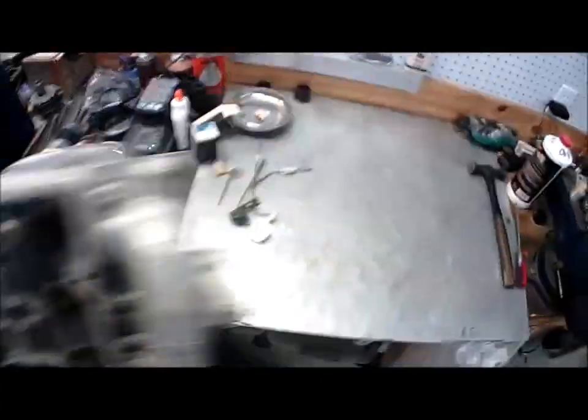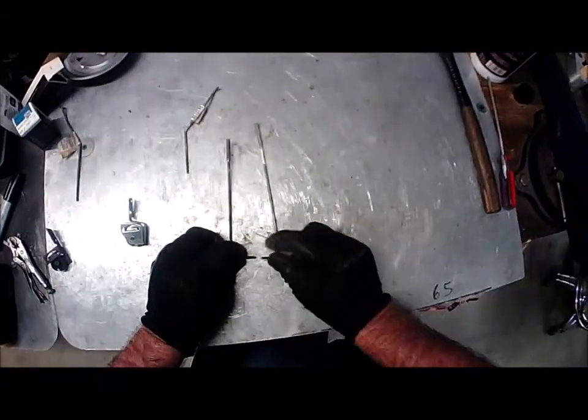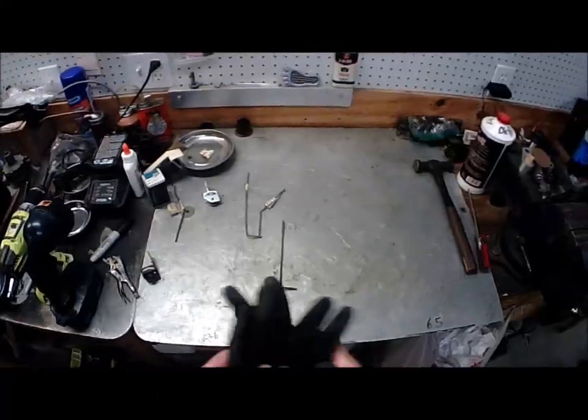So that is the difference between late model and early model choke stuff. I've got these all in NOS, but this center rod — the shorter one — is kind of hard to find anymore, because most people have gone to the late model choke setup. That's how that works. Clark's only sells the late model ones, and most people use the late model setup because GM figured out it was a lot better — that's why they changed it mid-63. So if you're going to do it, use the late model stuff. This is Dave Motohead, it's really getting hot out here — 112 degrees outside and probably 100 degrees in here because I don't have air conditioning. Thanks for watching.